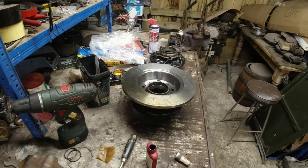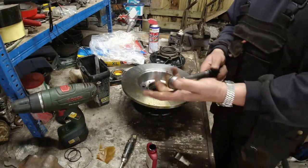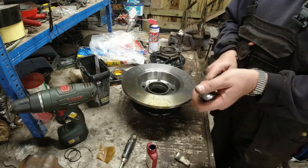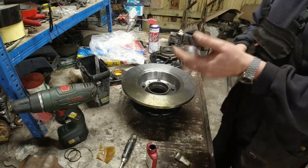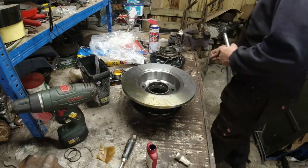Right, so 38 or 40 foot-pounds, we go for 40. That's what I like. So my little trusty torque wrench here, I normally leave it completely off. So, yeah, it was off. I take it down to the minimum torque when I leave it parked. That's 40 foot-pounds. What I always do with this thing is give it a little wake-up call.